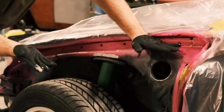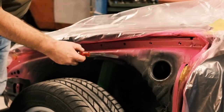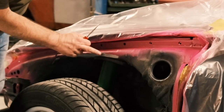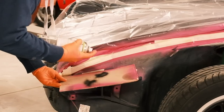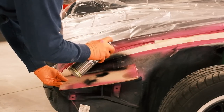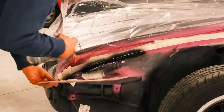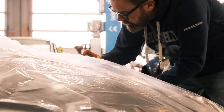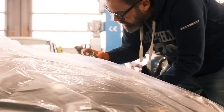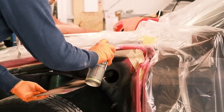By cleaning off the remnants of Porsche's body sealing tape, some of the stone guard was removed too. In order to bridge the hard edge created by the wire wheel, I apply a little body sealant and then cover it with new stone guard. I never apply these products directly on the panels, because neither is the strength of their adhesion very high, nor do they keep oxygen away reliably. So whatever goes on the panel, the first layer will always be epoxy primer.